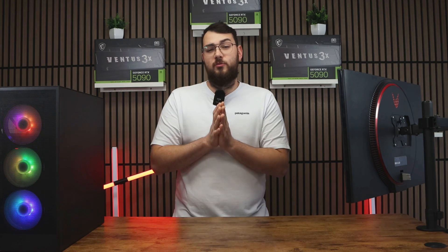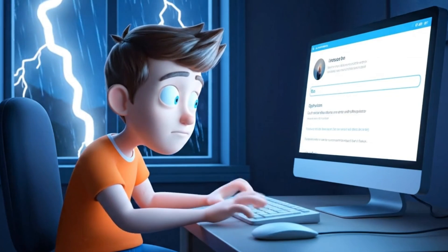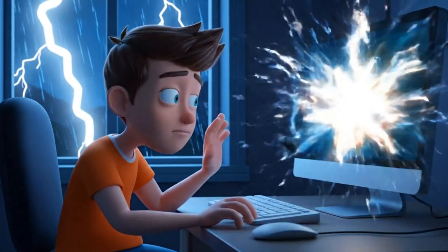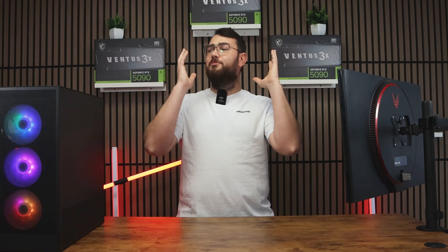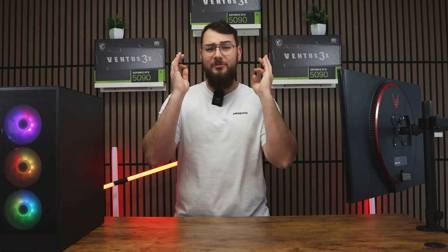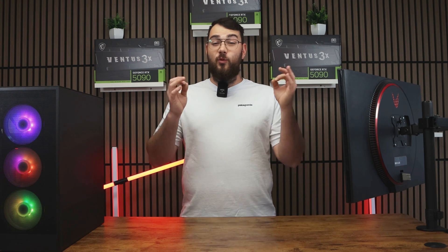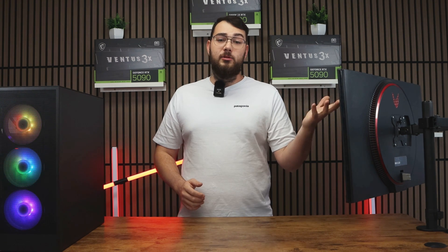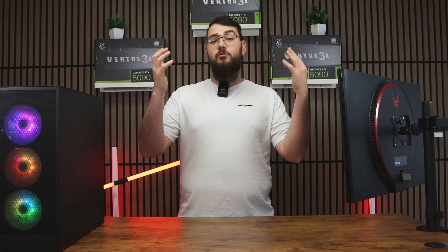As a really important reminder: do not turn off your PC during this process, and definitely don't do this during a thunderstorm. If your PC loses power mid-update, you can break your motherboard, resulting in hundreds of dollars being thrown in the trash. The update usually takes about five to ten minutes, and when it's done your PC will restart automatically with the new BIOS installed. You can double-check by going back into the BIOS and confirming the version number matches the one you downloaded.